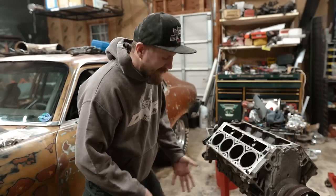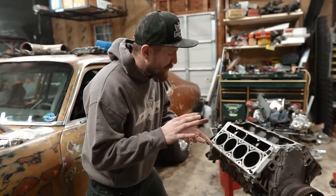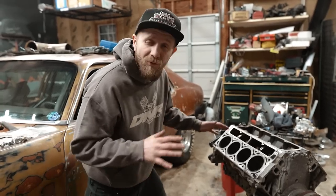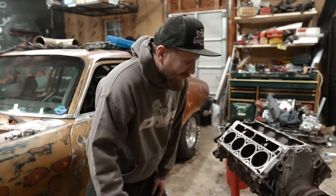Why am I taking it apart, you might ask? We're doing it all. Cam bearings, main bearings, rod bearings. Probably not going to touch the rings because there's nice cross hatching in there and the pistons were all marked where they go. But throw the Texas Speed cam in there, destroy a converter, you know, just normal stuff for a Tuesday. Once I can get this bolt off.